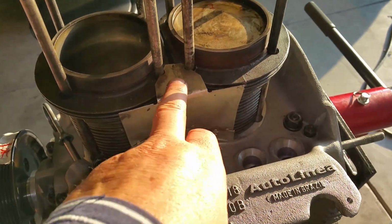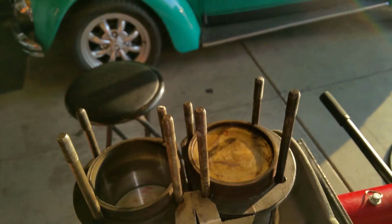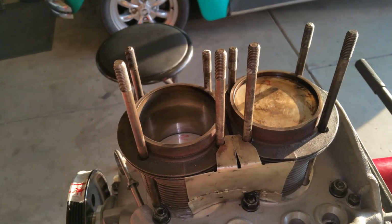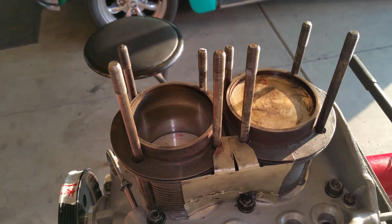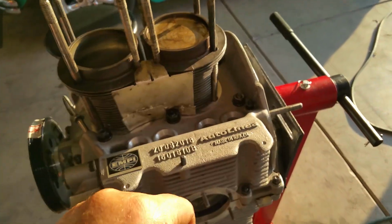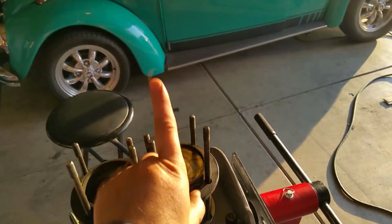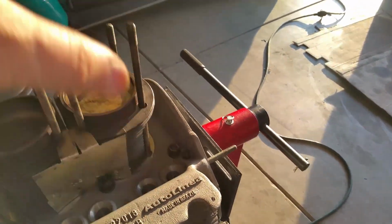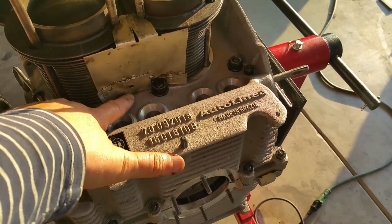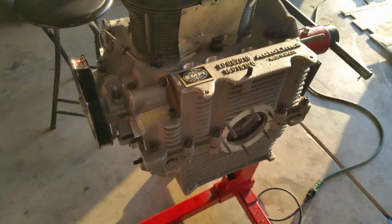I've got my air deflector on the bottom. I had to modify this one because this is a longer long block because of the H rods being longer. They're 5.5 instead of what are the stock ones? Yeah, they're 5.4s, and I got 5.5, so it makes everything longer. Plus the stroke makes everything, this guy, go up higher. So that's why everything got wider. Just weld some things on the bottom to cover up that thing and get the air to deflect to the sides. That's all you have to do. It's not really that difficult. All right, so that is done.